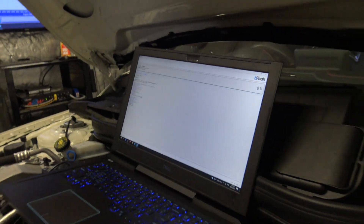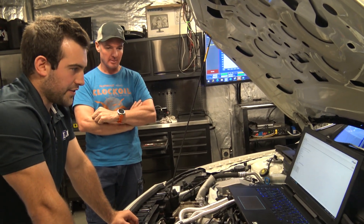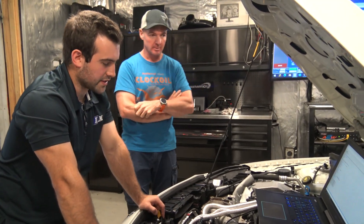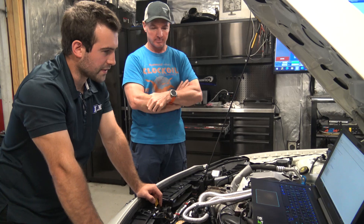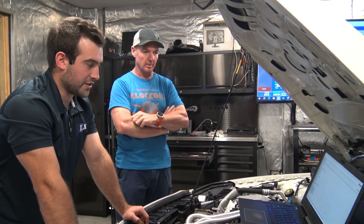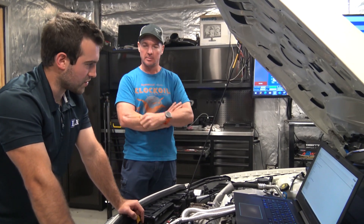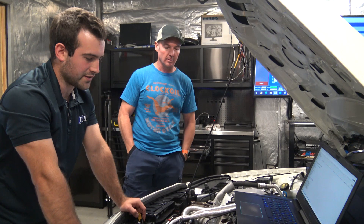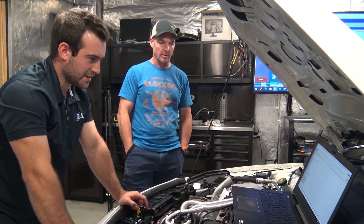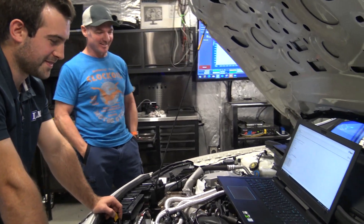Once that's read, I'll basically take it over there, tune it, and bring it back here. With the facelift gearboxes they have a different map address for the race start engine speed set point - I know the factory is like 4,000 RPM. There have been cases where I can't find it, so hopefully we'll be able to find it today for the race start. Sometimes I just don't know where it is. With some of the facelift models in the DCT they changed the race start logic, or maybe just the way that it references the maximum engine speed during race start.